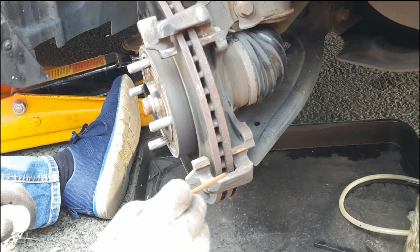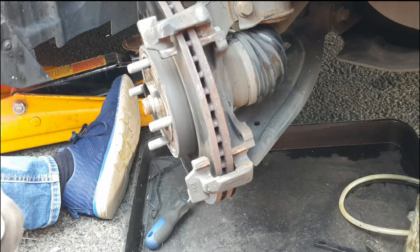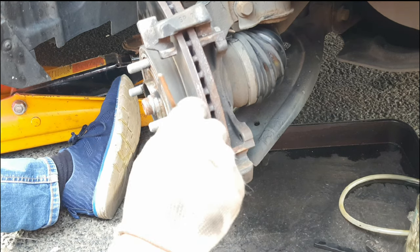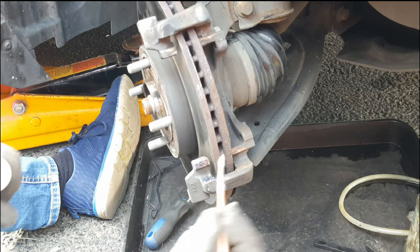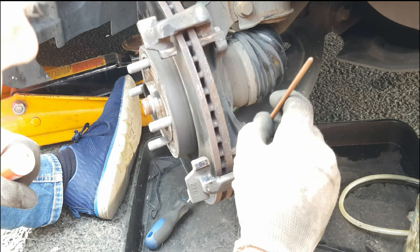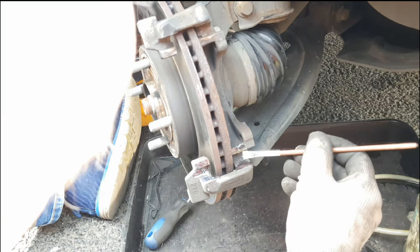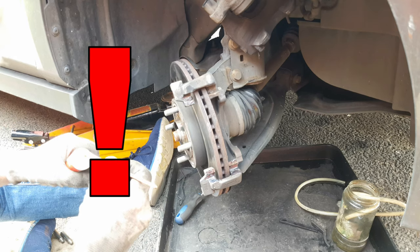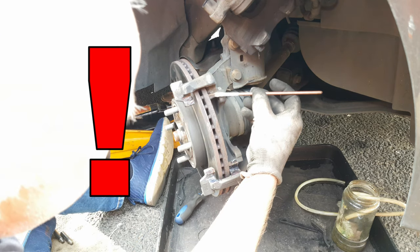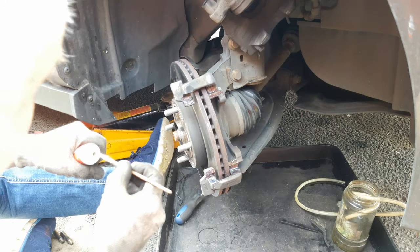The contact points for the pads on the carrier are here and here. With a small brush or small wooden applicator, just put a small smear on those contact points — all four contact points on the carrier. Although there's a gap to the pad from the back there, it might be useful to put a little in there too — do that top and bottom. Make sure that you don't get any on the disc, which is why we're using a small brush rather than using your finger or squeezing the tube directly into the space.